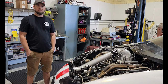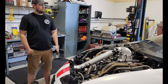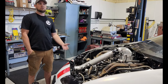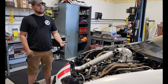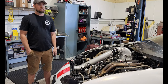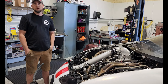It's a larger cam than we've ever run, and basically an improvement with the cylinder heads, which should flow better, the valve size, the runner size, the cam. All that's an effort just to make the engine spin more RPM, because we're at the point where we really can't go any taller with our rear gear. We're a 340 gear, it's a Pro Gear 9-inch. So to physically go faster, we're gonna have to spin more RPM. Everything was spec'd with the intention to turn it 9300, 9400, maybe 9500 if we have to. Last year's engine, we turned it pretty much all season to 9100.